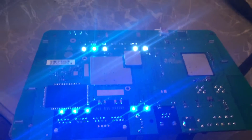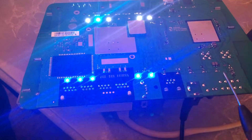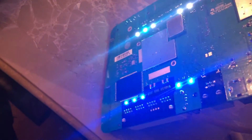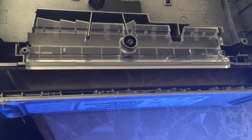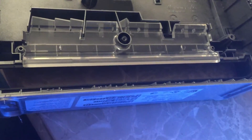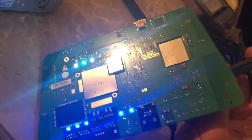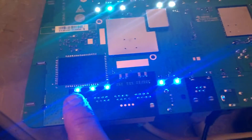A lot of people are confused about the signal with the Huawei modem. Down here are all the signal lights for the Huawei modem. If it was lit up completely, you would have full signal. It's pretty difficult to tell. If you look at the bottom of the case, that blue light on the bottom — if you had full signal — would be completely lit. That's one way to tell. Right now I have four lights for the signal. As I play with the antenna, it goes up and down. These three lights just mean the unit is on; these lights are all your signal lights.